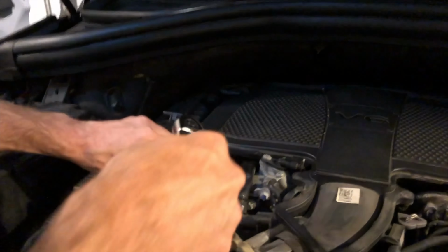Okay, and just crank down on it. And as you see, it will loosen. So let's get the belt on it, and that's how we'll get the belt around it. So we'll loosen it up, and then the belt will slide right on. Just remember, put the belt on all the pulleys in the route, and leave the slack over here for the tensioner. And then when you pull down the tensioner, you can just loop it around there. But I mean, if you could, you could basically do it around any pulley once that slack comes down.